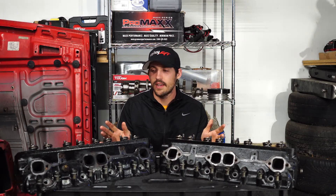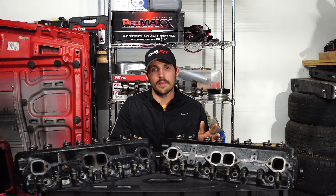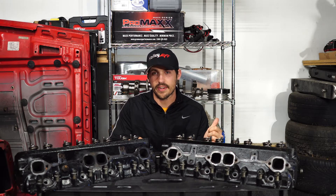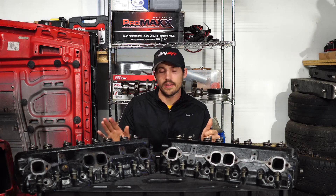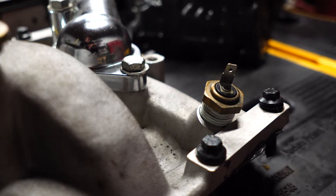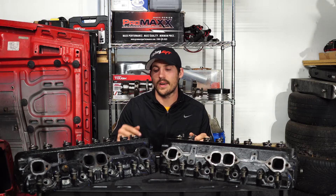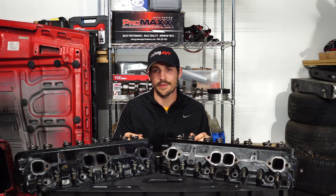The first big disadvantage: these are going to bolt right up to your block as usual, nothing changes there. The big change is the intake manifold — that's going to have to go. You're going to have to get a new one. These use a totally different bolt pattern; they use a vertical bolt pattern instead of the angled bolt pattern like the normal Chevys have. That intake manifold can range anywhere between a couple hundred dollars or however much you want to spend on them.